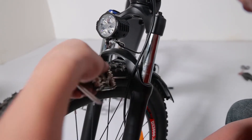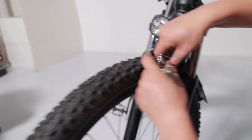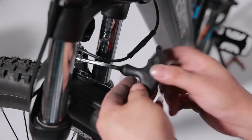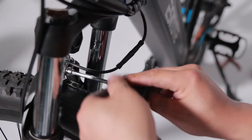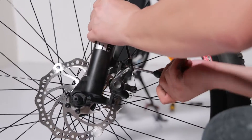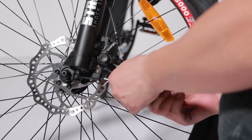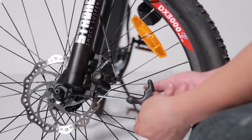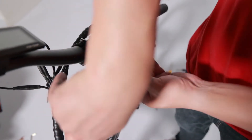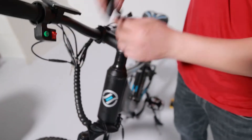In this video we're looking to replace the front forks. Start by removing the brake lines — we have a screw up on the fork here. Now start to remove the front light. Now we need to loosen the top of the forks from the bike using these three screws.